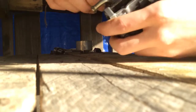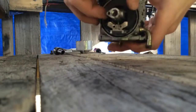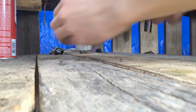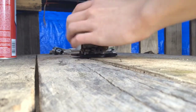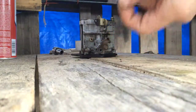Pull this little pin out. There's going to be a little pin where this thing pivots — the float pivots on — and there will be a little pin that holds that in there. Hopefully I won't have to go get the pliers; sometimes they slide out pretty easy. Do not lose that little pin. It's small — do not lose it.